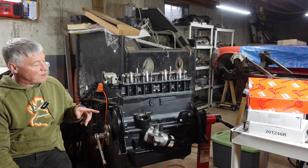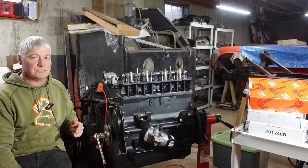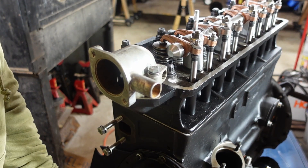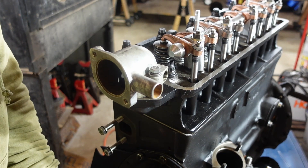I'm going to put on the original pulley real quick just to find top dead center and make sure that all still makes sense, or else I might be going back and doing this all over again. We're going to find top dead center on the compression stroke and then get that gear in. All right, so you're watching this valve cycle here.